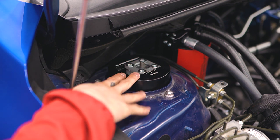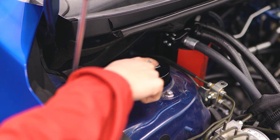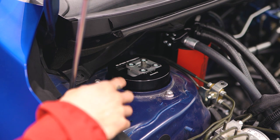If you find yourself needing more than that, we can come up to the top where we have some camber plates installed. These are going to allow you to easily adjust your camber — all you have to do is loosen these four bolts, and that allows you to slide the strut freely. Once you have that dialed in, tighten those bolts down and you're set. It's going to give you about negative two to negative four degrees of extra adjustment.